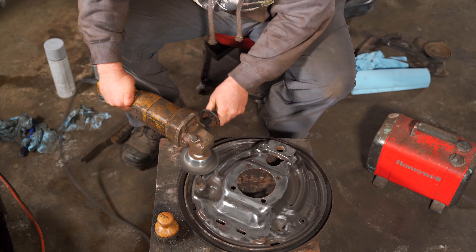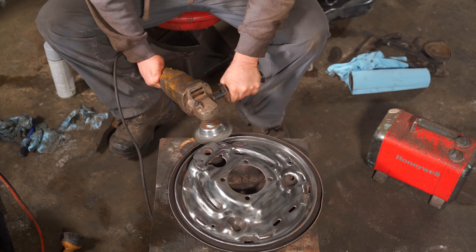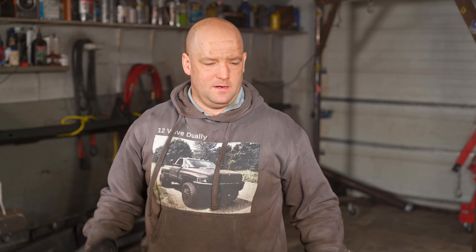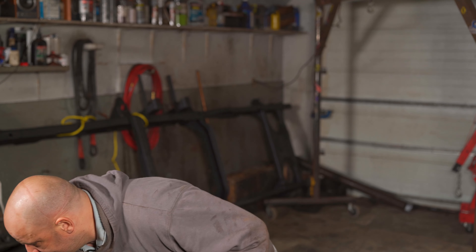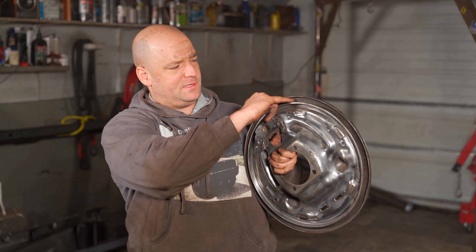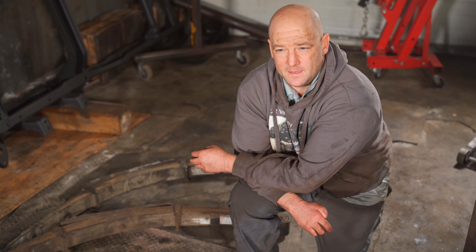First clean-up on this backing plate — I was really hoping these could just be cleaned and continue to let the original paint do its thing, but there's definitely a bit of surface rust, so this will need to be brought down to bare metal and the whole thing painted again. Being that they are brake parts, I'm going to have to do a little research — I'm not sure if certain types of paint are better suited to brake components, or if there would be a risk of things melting under really high heat. All the metal is there and it feels pretty solid, but this is going to be a lot more work now. There are a lot of nooks and crannies — getting something like this down to bare metal is never that easy, but we'll get through it.